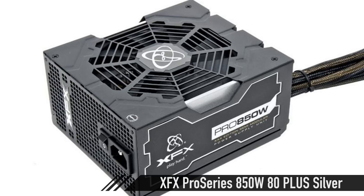For the power supply, XFX Pro Series 850 watt. It's an 80-plus Silver certified power supply. XFX uses the same boards that Seasonic does, so they're going to be really nice on the inside — quality parts. There's one nice 12-volt rail in that as well. 850 watts is more than enough power; you'll even be able to add to the system later. It's $119.